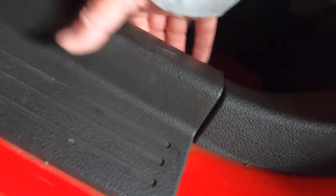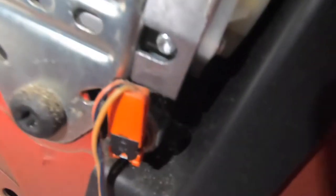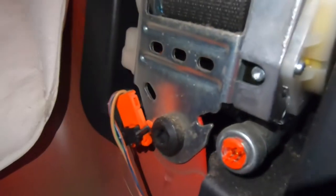I'm going to pop these two clips out. To get to the seatbelt, this cover just pops off super easy - this black one right here. Once you pop it off, mine has a 14 millimeter bolt right there. Now I'll show you how to get this panel off on the other side of the car. You just pry the cover off - it's just a couple of clips. You've got to get this little orange clip out; it's a little black part you just lift up and it pops out, super simple.